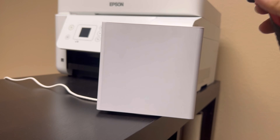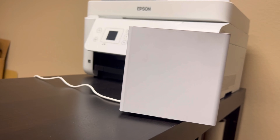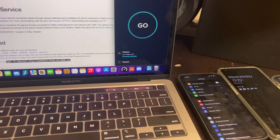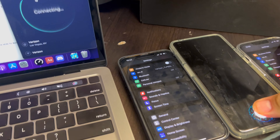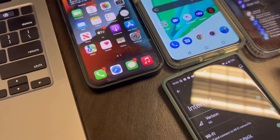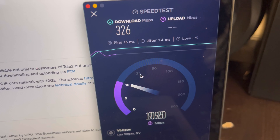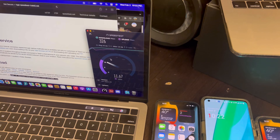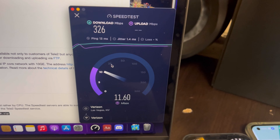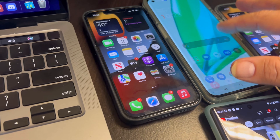Alright guys, we're back. Let's do a quick temperature check on the Verizon home internet box before we start. Side is between 103 and 110. Top is 115 — confirmed at 115 again. There's no airflow so it'll stay as is. We've got four phones all hooked up to Verizon. Baseline speed test: 13 ping, 1.4 jitter, 326 down by 11.6 on the upload.